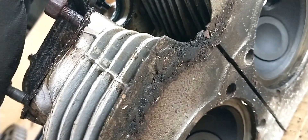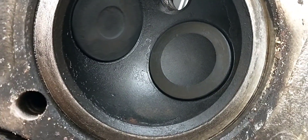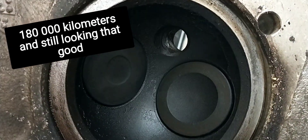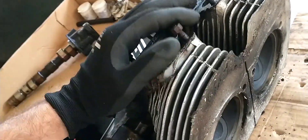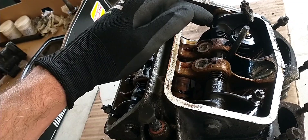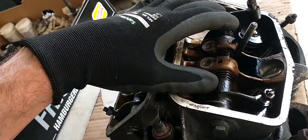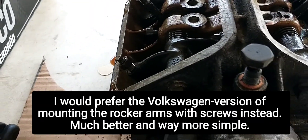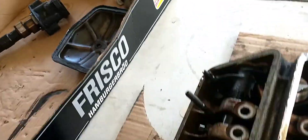I'm also going to clean this up because it's not looking nice right now. Look at these valves — they're pretty fine, not burned at all, so this is going to clean up very nicely. When grinding the valves on the GS engine, you don't need to take the rocker arms out. Sometimes people do take these out, but it's a pain to get them back without the seals leaking. You don't need to — it'll be just fine with the right tool. An ordinary tool won't do.